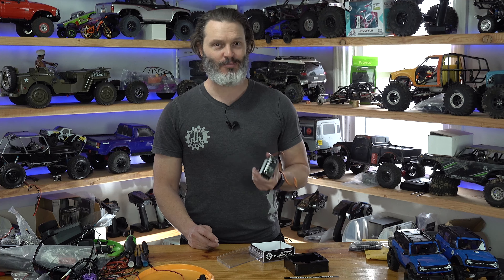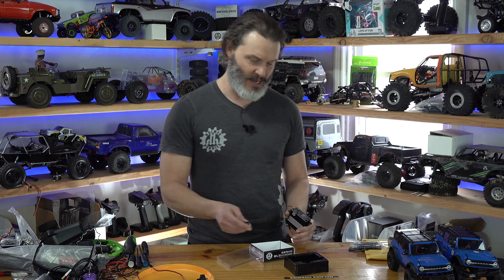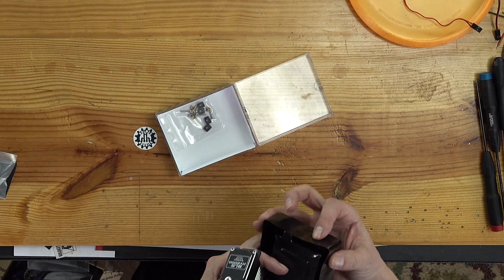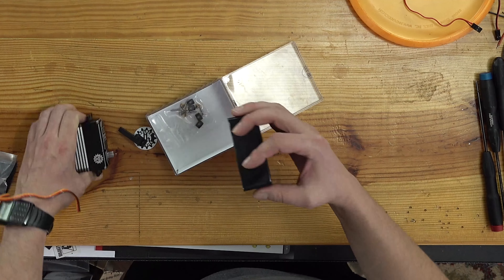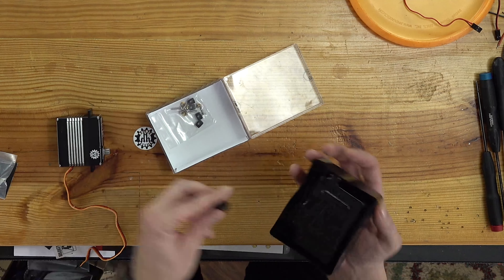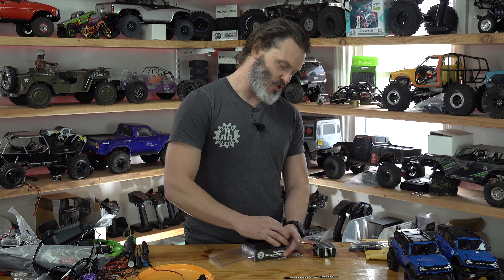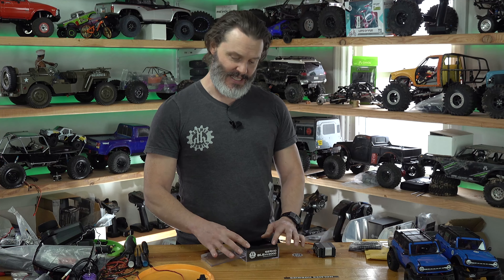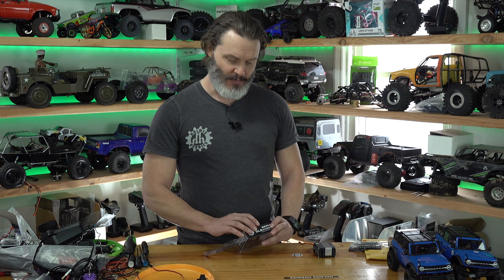It is definitely not something to be playing around with. You're probably going to have to upgrade some parts to make sure you're not bending your frame, bending the panhard mount, and everything — I know that's an issue with the SCX6 — but there are plenty of companies with aftermarket parts available. So essentially, other than potentially bending some portions of your rig, it is a drop-in replacement in the SCX6. I would recommend a BEC with at least 10 amps of power, if not more.